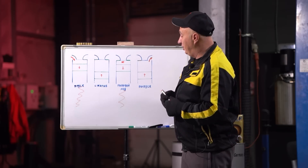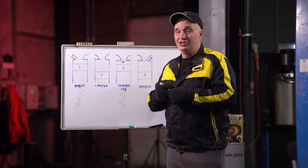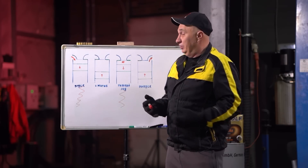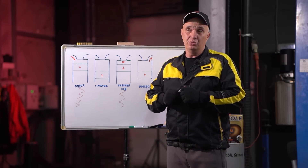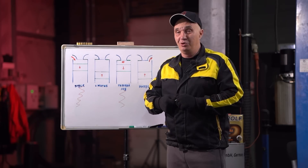But then we also have the compression and exhaust strokes. After the spring has compressed and exerted all of its potential energy, there is a bit of time left while it's not under tension to slightly stretch it out. We're also forgetting a key component, which is the flywheel, and it is actually going to be helping us out a lot at this phase — it's not going to waste the same amount of energy required to stretch out the spring, but while the spring stretches out and accumulates some energy, it'll then give that energy back to the piston. But this is all just theory, so I suggest we take a car, go out for a drive, and measure the acceleration on the stock motor to 100 km/h. Then we head back to base, do this spring mod, and do another round of testing. Let's go.